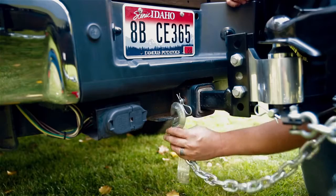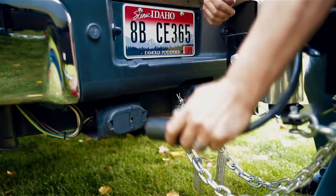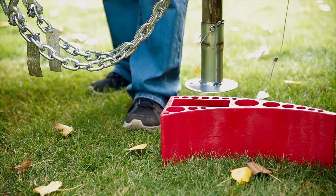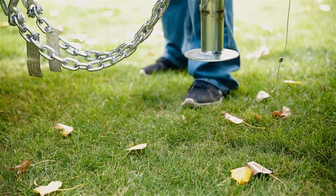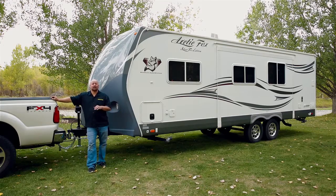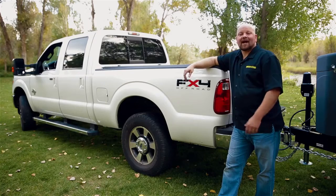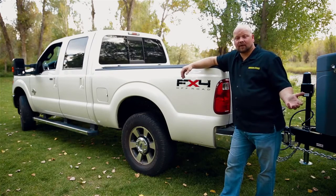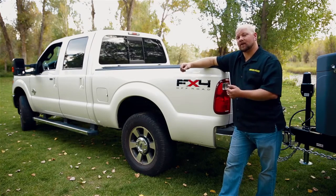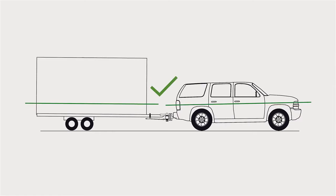We can now go ahead and hook up our chains and our power and let the jack out of place. Now that our installation is complete, we're going to sight-level the trailer. The most important thing is that your trailer is towing as level as possible. If you're a little high, that's okay. If you're a little low, you may have to bring your ball housing up one or two notches. For the tow vehicle, make sure you have adequate suspension for the size of trailer you're towing. Different vehicles have different suspension, so the height difference will change depending on the vehicle and trailer combination. Make sure you're not getting any extremes — front end way up or way down. You want an even distribution of that weight.